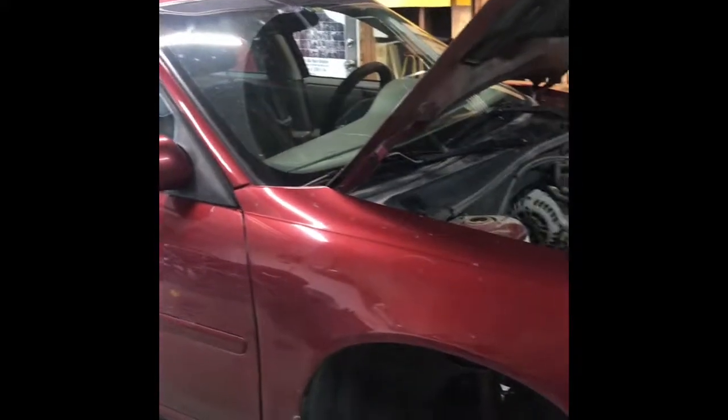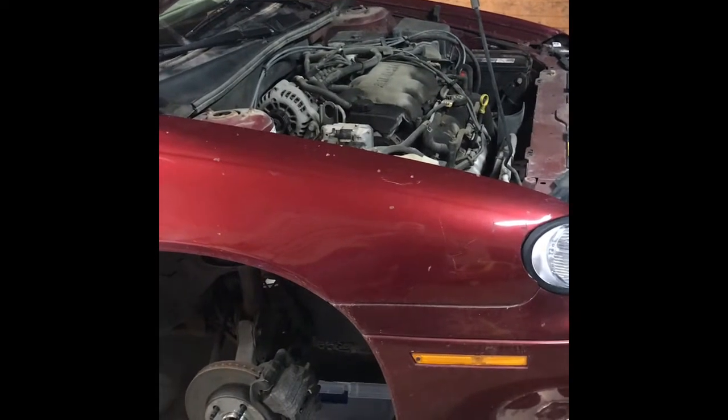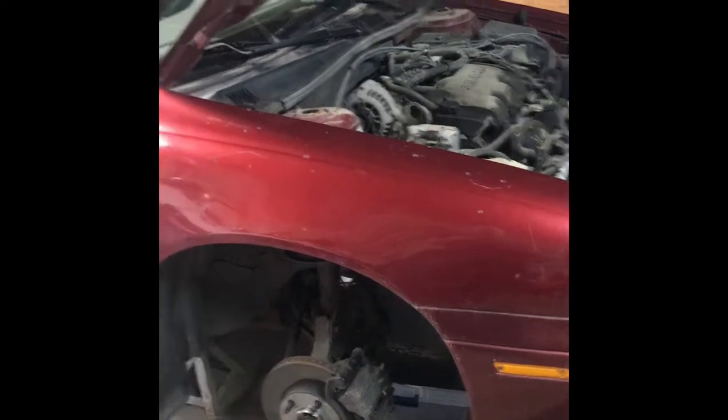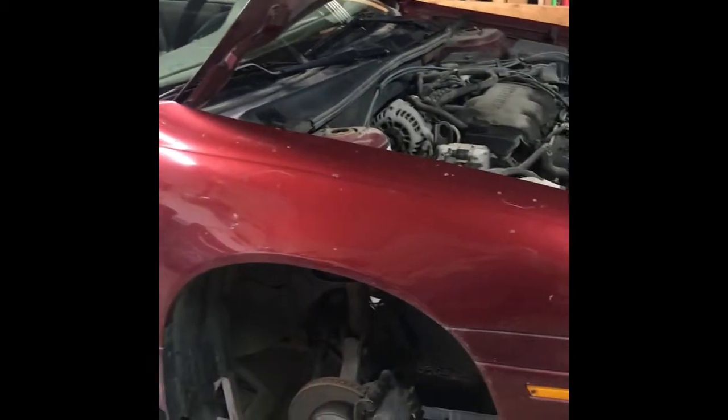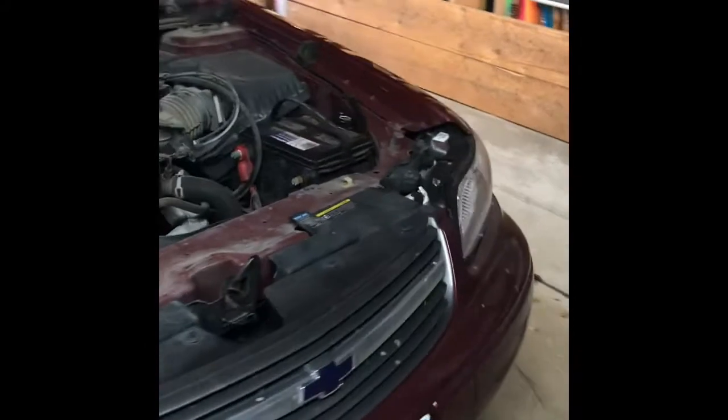This is a 2002 Chevy Malibu. I found videos that show how to change the axle seal on the passenger or right side of a 4T40E transmission. This side, when you pull the axle out, there's a stub shaft that comes out with it down there. And the seal is much easier to change on that side. But I haven't found one for the more difficult left side or driver's side, which when you pull the axle, here it is, does not have a stub shaft.